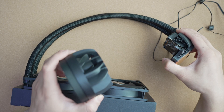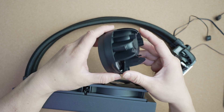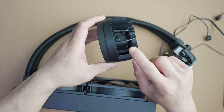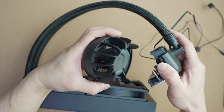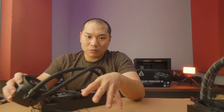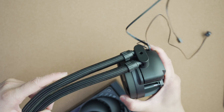You still have a VRM fan, but what's improved is that it's bigger — spinning from 400 to 2,500 RPM. That little propeller sits in a separate pump cover, which clicks into place magnetically. The LF3 also addresses one of the pain points with the LF2: the thick braided tubing came straight out of the pump block, making bending or orienting things difficult. Here, they've added elbows, which is nice.